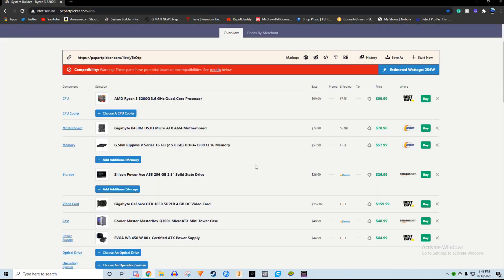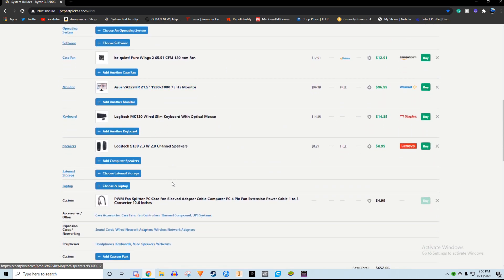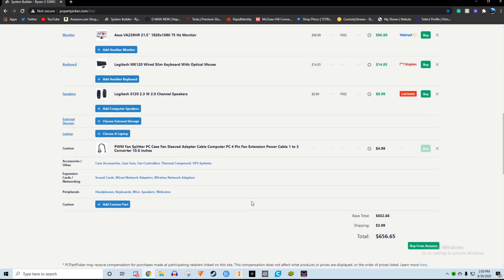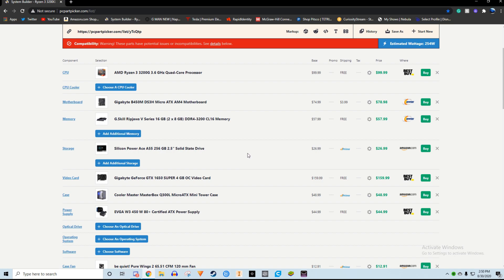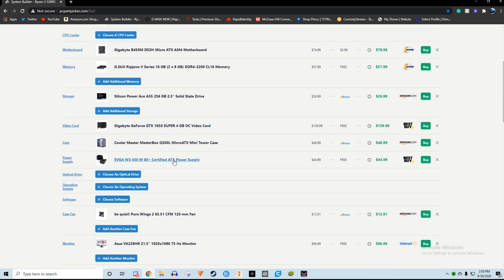Here in PC Part Picker we're going to go over the list, see what alternatives you can do, and what I'd recommend for an upgrade path. We have the fully upgraded PC shown here. The things we didn't buy would be this graphics card — we didn't buy the case, but you're going to have to buy one. We also didn't have to buy a monitor, and we did end up buying the fan splitter. For more FPS in games, I'd recommend adding a discrete GPU like this Gigabyte GeForce GTX 1650 Super for $160. This case comes with only one rear fan, so you'll need the splitter and a second fan for better airflow with that GPU.